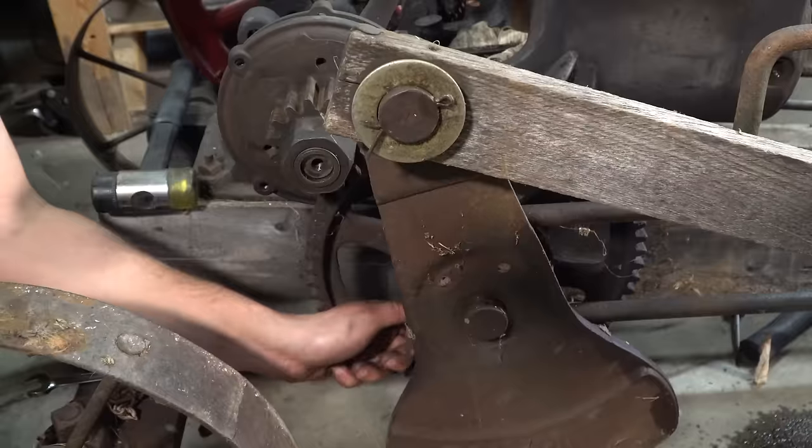I'm using a piece of wood to lightly tap out the massive six-inch piston — this thing is bigger than anything I've dealt with before, by far. The top piston ring is actually stuck, which is a major issue to address. I'm hoping to remove the entire engine block at once, but it's heavy enough that I can't lift it onto my workbench alone. The gas or kerosene tank is just nailed on to the wooden frame hidden under the engine block — an extremely inconvenient location to fill, but that's just the way it is.